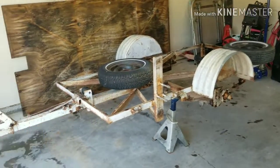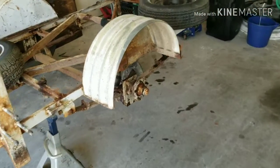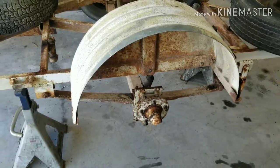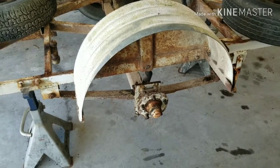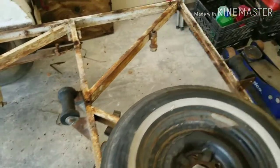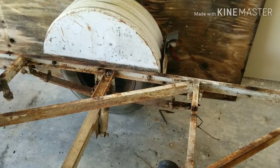It has a straight axle with a bolt-on hub that I'm going to have to change out to get four-lug, because I want matching wheels to the Miata. The Mini Cooper hub should just bolt straight up — I'll need to drill some new holes. I'm also going to cut the rollers off since they're welded on, along with some other random welded-on bits.